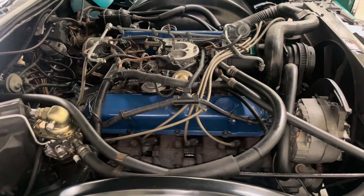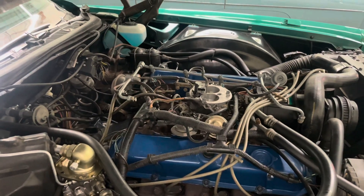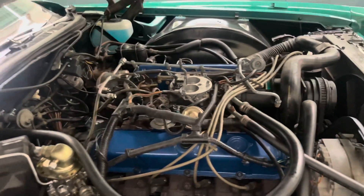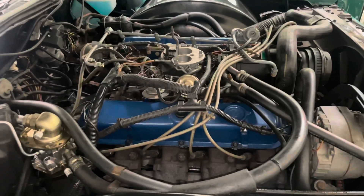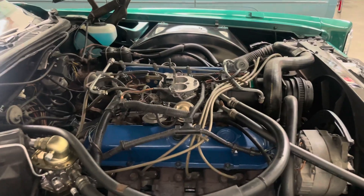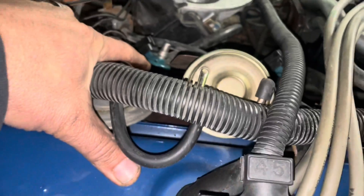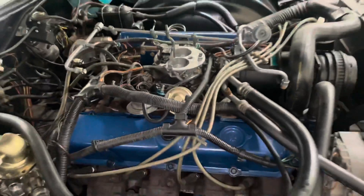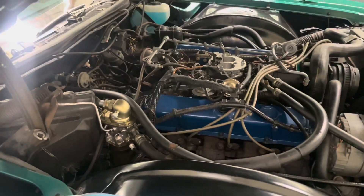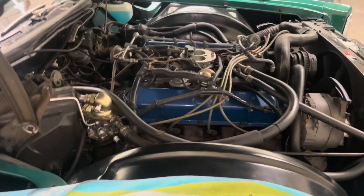Here's a little interesting food-for-thought headache that I've been dealing with. Multiple sets of injectors that we've gotten for this car — OEM rebuilds and 100% new — they all leak. They leak from the top of the injector, like on the OE ones right here where the blue top is assembled. Put another set in, fired it up, and we have a leak at three of them, but it's where the injector goes into the rail.